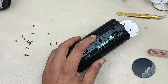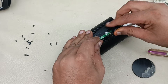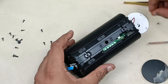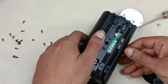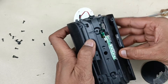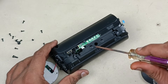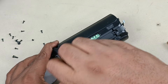One is here, the other one is hidden behind this indicator. You can see one more screw here. Now you can take out the metal grill — slowly sliding this out, it will come out like this. Now there is a bit of dust here, I am going to clean that. Now there are three screws here which we have to remove to split apart the speaker into two halves.